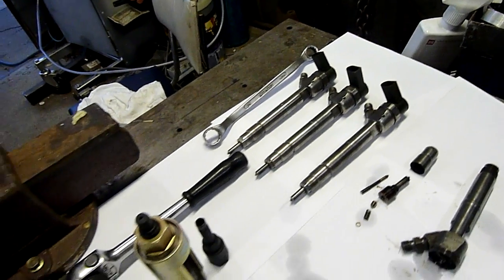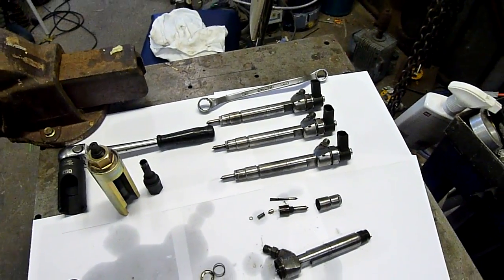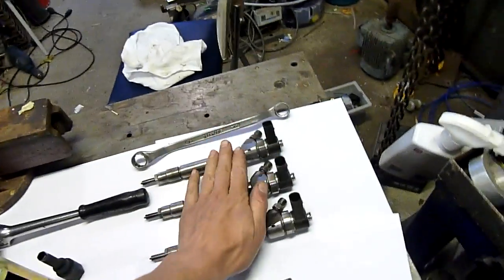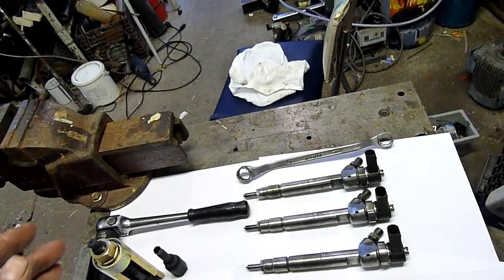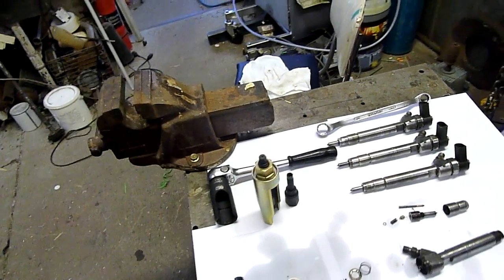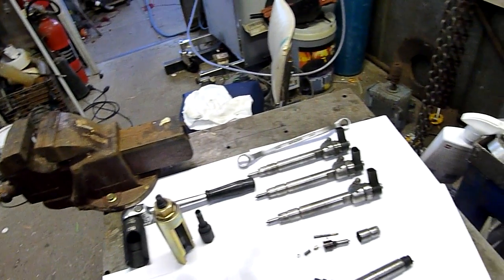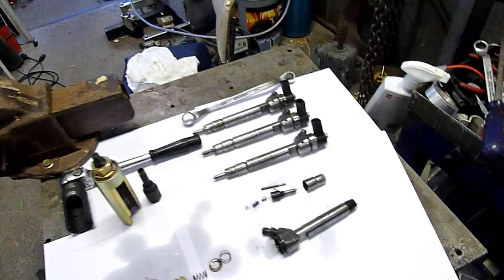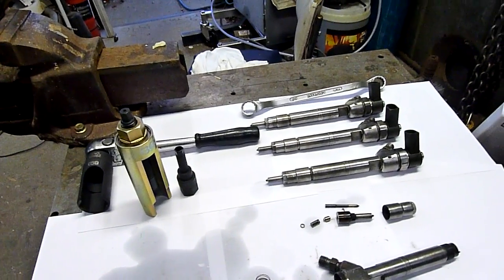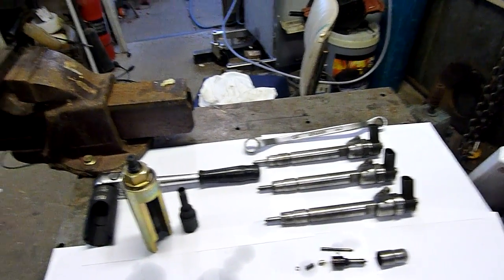That way I've got something I can swap into the car whenever I want and be done with it. Granted, I'm still a couple of cylinders short. At least that's three, and then the three I take out of the engine I can send off to AG Diesel — if two of them come back good, well, I'm all in the green. Still got to fix that air leak getting into the diesel system first though. I'll do that, then I'll look at injectors. I know there's definitely a leak down — the fuel rail loses pressure very quickly.